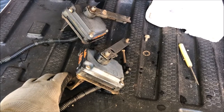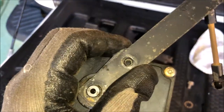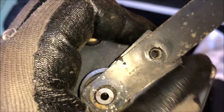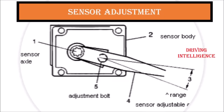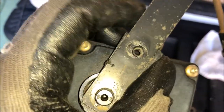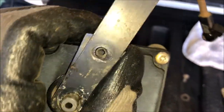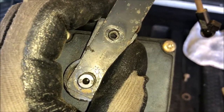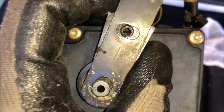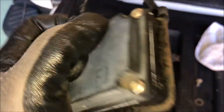After disassembly and cleaning I've reassembled most of this. One thing I found through internet research is that this arm is adjustable — it gives you some adjustment range on the ride height. Depending on where the arm is positioned you can get additional ride height or reduced ride height, so do that at your own discretion. It's a little hard to find any information on these, but that is an interesting element — it's an adjustment on the electronic level control module.